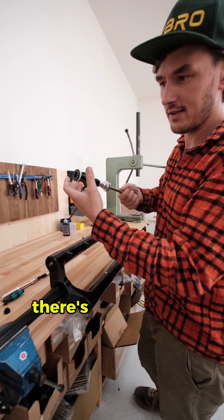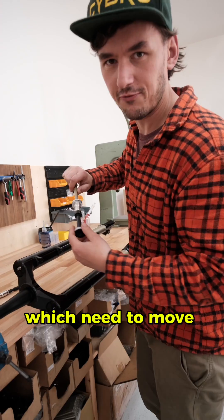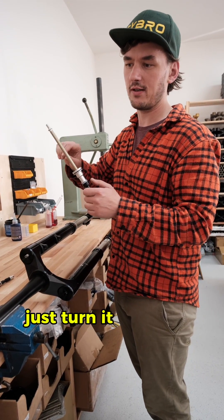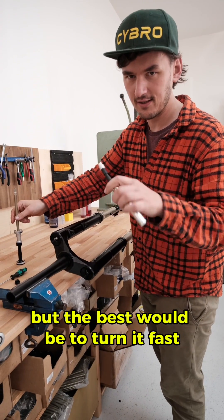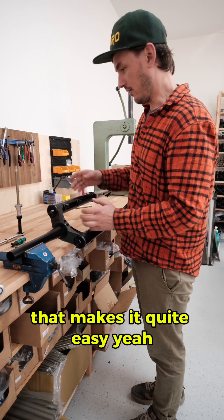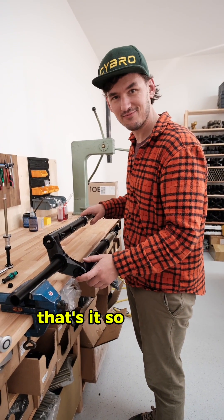The reason is that on the Travelizer unit, when you are in an extreme position there is some small torque on the two parts which need to move freely again. If you are at the minimum or maximum position, just turn it a little bit faster in the opposite direction. But the best approach is to turn it fast with the shock pump still attached — that makes it quite easy. That's it, have a good ride!